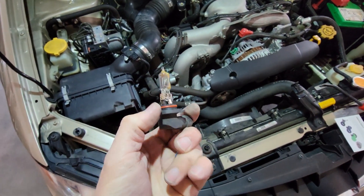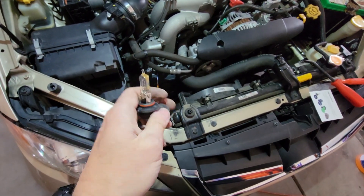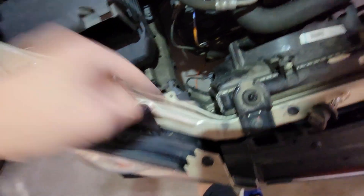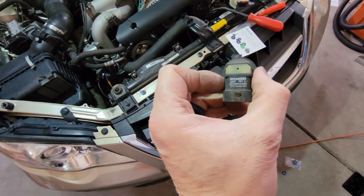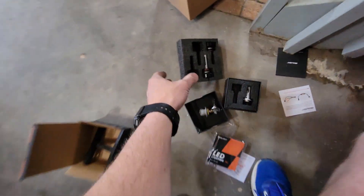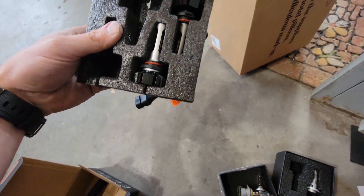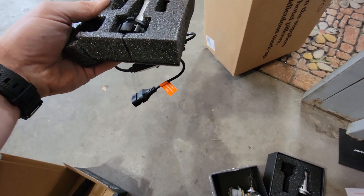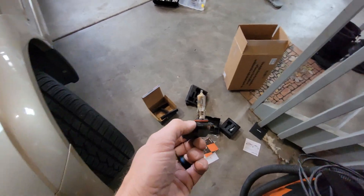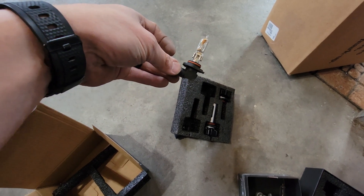I'll make note that these bulbs look like they were on their way out — you can see that discoloring. That's an indication this bulb is getting hotter than it should. On the back of the bulb itself, that is a 9005, HB3 is the other moniker. On the lights themselves, they mark them so you really can't goof the install. Pay attention to the gasket on the bulb — if you've got an orange, put back the orange. Now we're going to do these last two lights and the fog lamp.